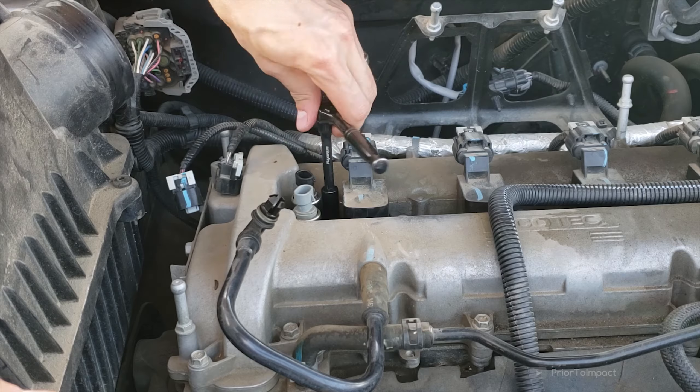I have positive and negative terminals hooked up to the SUV. I'm going to put a nail in the end of the positive and negative — just like that — and then I'm going to touch them against the little leads. You've got to be careful not to short out the nails against each other, because you can start a fire. If they accidentally touch, they might melt together. What I'm doing is hitting it with 12 volts over and over again to unstick the solenoid, so that if it's getting stuck at some particular point, it unsticks itself.